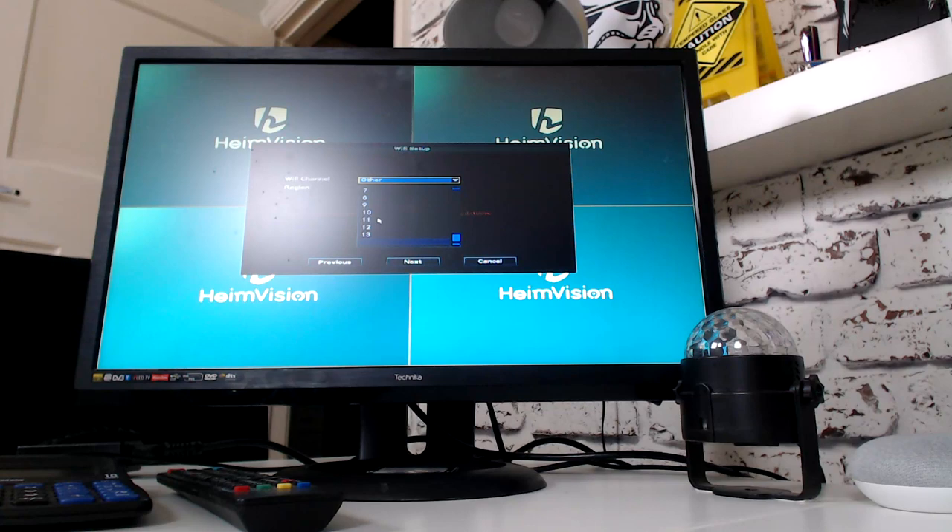Next is time zone setup. We're in the UK, so GMT at the moment. The date is the 23rd, time is 14:44 — that sounds right. Clicking 'sync time' will sync with the server. Then it tests the LAN connection and detects your network — you can see the cloud IP. And there we go — our hard disk: Western Digital 320GB. It's formatted. Actually the system is prompting to format it, so let's do that and see how long it takes.